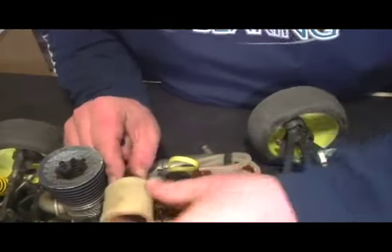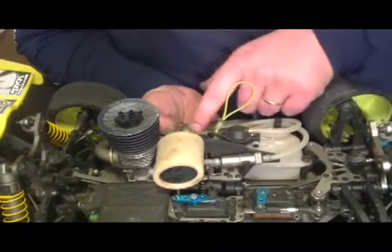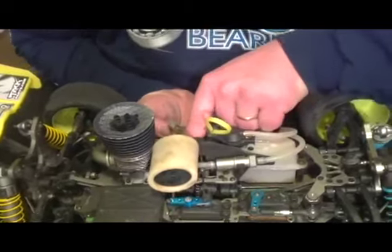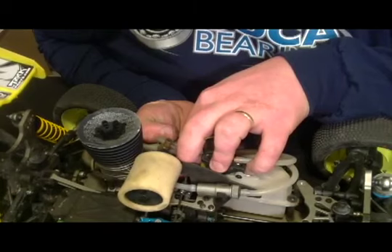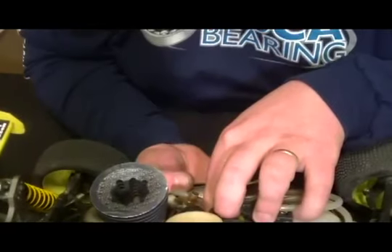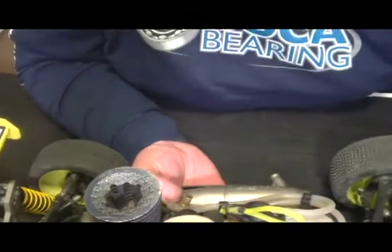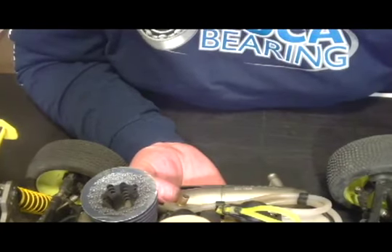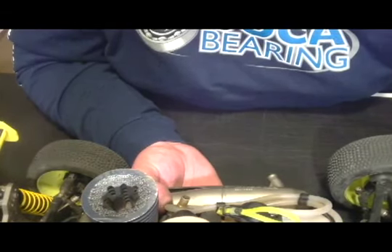Get a new zip tie for that. Last but not least is our air cleaner — and there we are. One thing to always, always check is to make sure you've got good play between your clutch bell and your flywheel. Put one finger on the bottom and use the other on the clutch bell — you just want just a little bit of movement when you hold the flywheel or spur gear in place, so your clutch bell moves just a touch. You can just barely hear it moving back and forth. That's about all you need to worry about for clutch maintenance unless you're replacing springs or shoes. The clutch setup I'm using is off a Team Associated RC8 — the three shoe system is extremely easy to use.